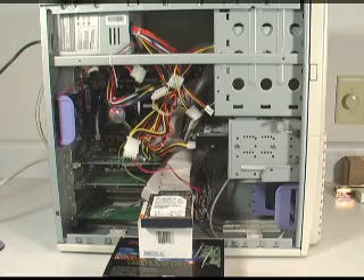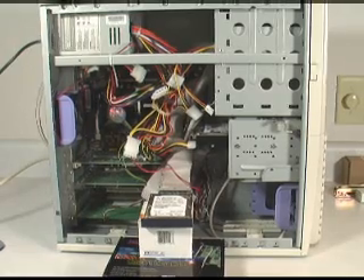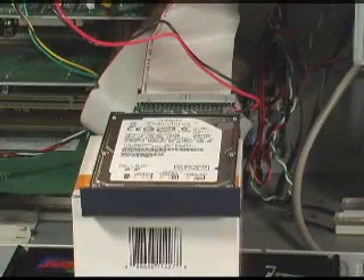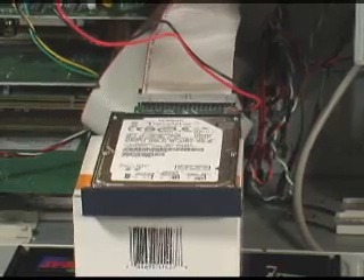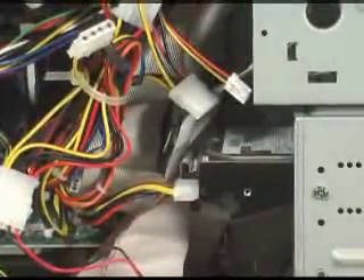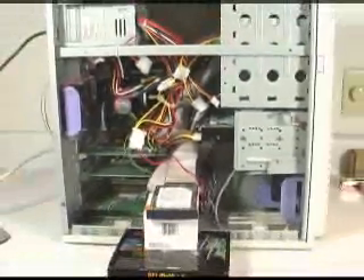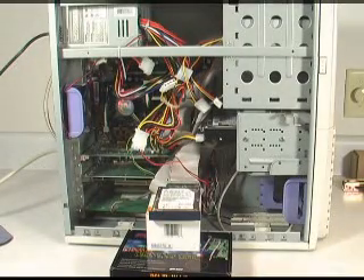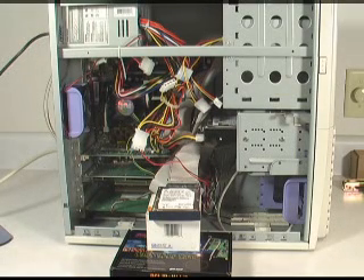Slide that together. Here we have our laptop drive installed in the machine. The drive is set up with an adapter on the IDE cable, configured as the slave. The C drive for the machine will continue to be the primary drive that we'll boot off of — just hooked up as a second hard drive. Make sure that we check the BIOS settings so that the slave drive is recognized, as sometimes it can be configured to be disabled. We want to make sure the slave is enabled.